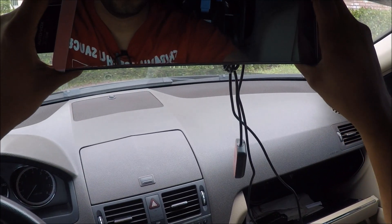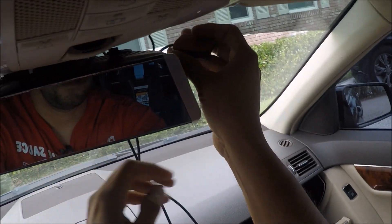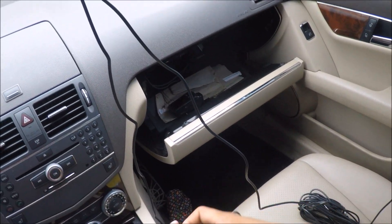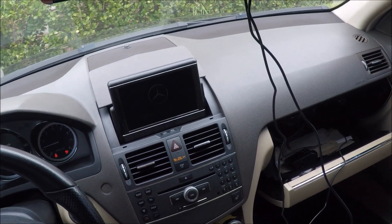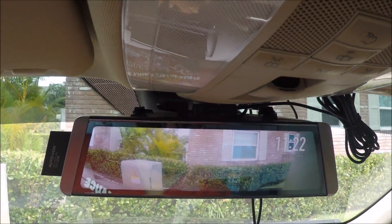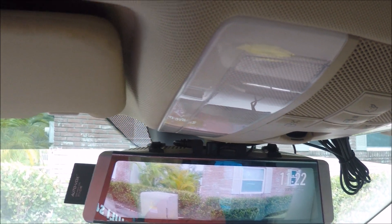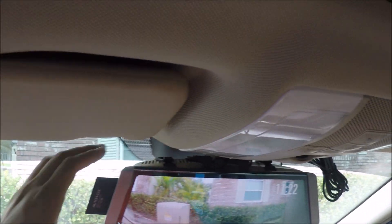In a German vehicle the L bracket causes a problem and forces the mirror to look down — I can't adjust it up anymore because of all these wires. For a professional install, you'd need to hide the GPS and run the cigarette lighter wire through the A-pillar all the way down to a socket, or get a micro USB hardwire kit and then the whole kit would work. Let's turn it on — the system comes on beautifully. The dash cam is recording in full 1080p, and if you toggle to the rear camera it is recording in 720p, so you can toggle between the two at will. The date and time are automatically obtained from the GPS, which is very nice, and you can make adjustments to move the screen up and down for the dash cam.